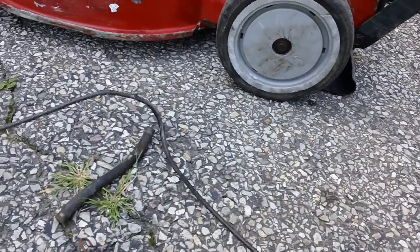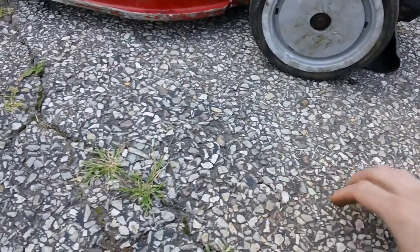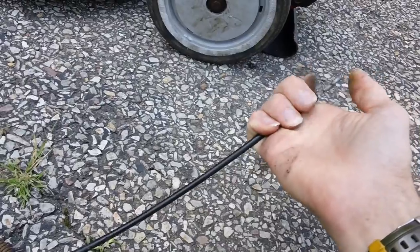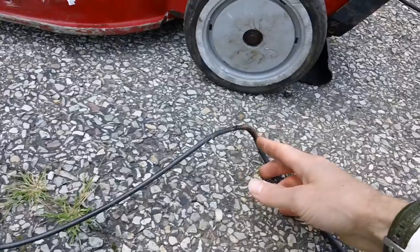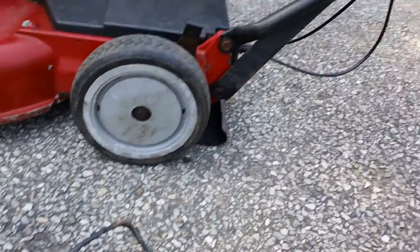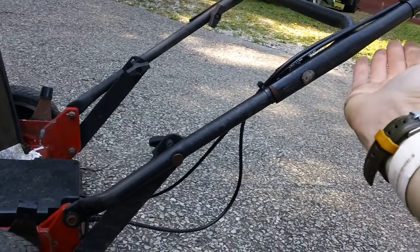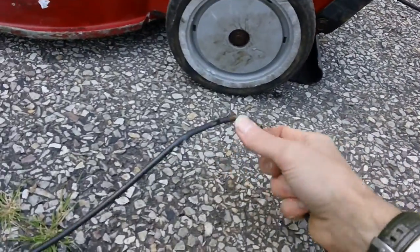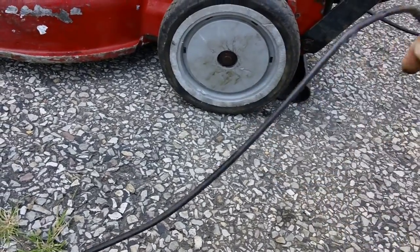Here's the cable — we had to replace the bail control cable. These cables are bent pretty badly. It's getting kind of stiff because there's a nice big kink in it. It looks like somebody tried to smash the cable between the two connectors. Typically people bend these things when they take them apart — they bend them forward or backward and it really screws up the cabling. The cable is quite significantly bent and it should be nice, smooth, and straight, so it had to be replaced.